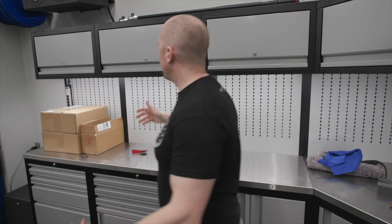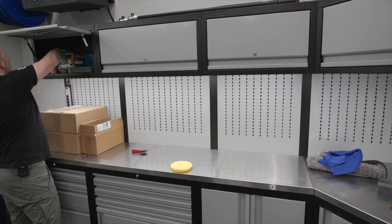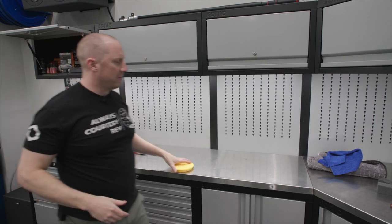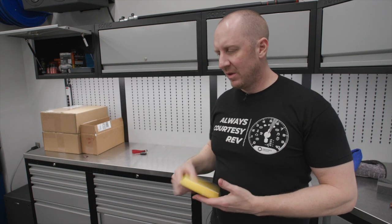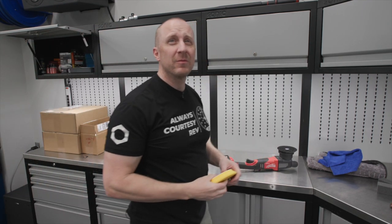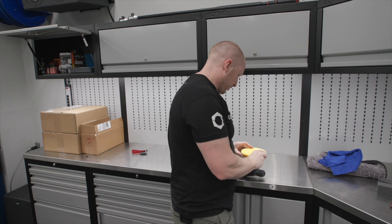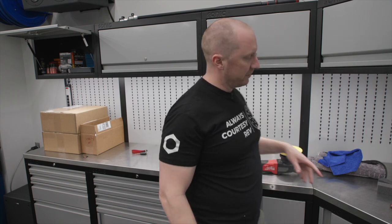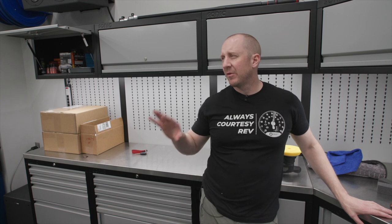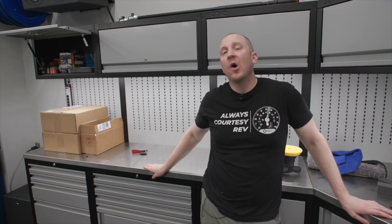Normally I would do Halo coating on the PPF, but I find it doesn't work on the XPEL very well. So we're not going to do that. Theoretically, I'm going to do some really simple perfect finish polishing. You can treat PPF the same as paint — I can polish this just like painted paint, with the exception that I want to manage heat. From my first wash, there's clearly no protection or coating on top of the PPF.